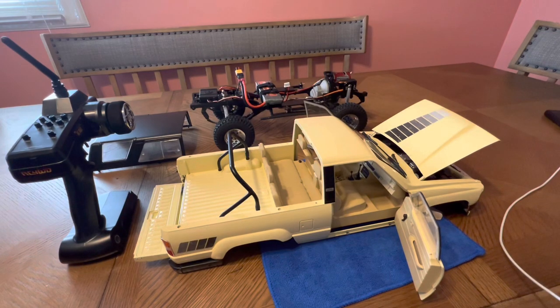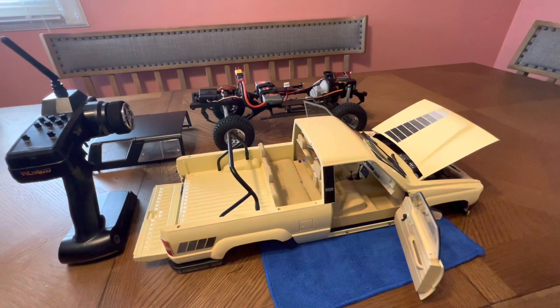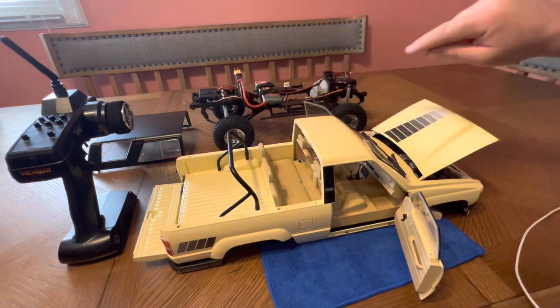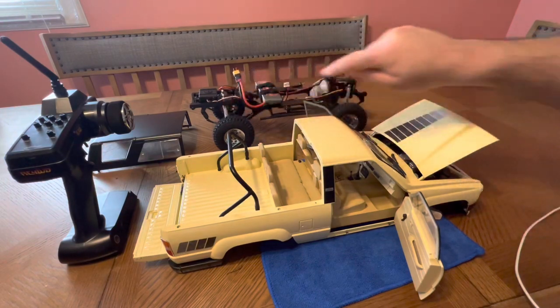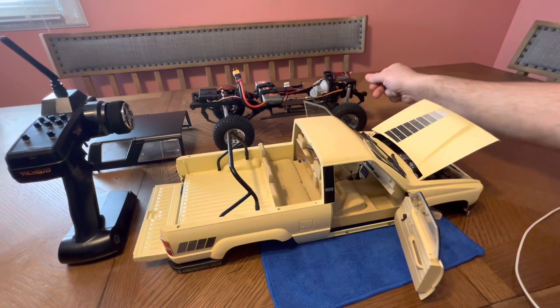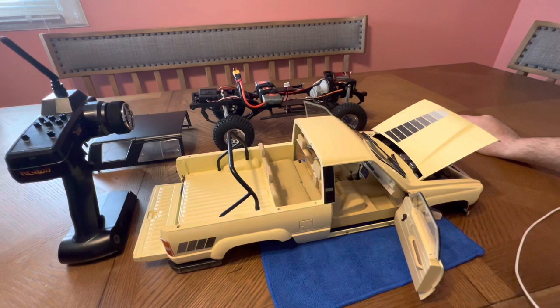Technically, we are upgraded. The video I shared with you guys on how to modify it for free, I did have these mods in this current video. You know, removing one of the leaf springs, removing the spring in the shock. And I ended up putting oil. I ended up compressing it all the way, dabbing, getting the excess off, putting the cap on. So making it to where it actually rebounds.